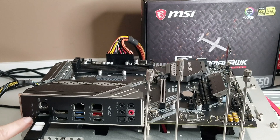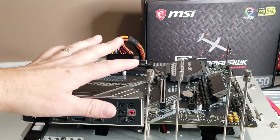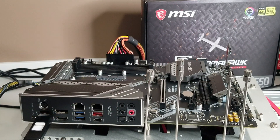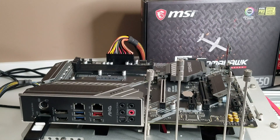There's a Flash BIOS button right here. All we have to do is turn the power on to the motherboard. There's a flash BIOS button — you're going to push that, hold it for about two seconds. You're going to see the lights turn on. Then just wait for the sequence to complete. The power supply will turn itself on, the lights should flash in sequence, and it should take no longer than about a minute at most. Just wait until you're sure it's done — it should power itself down, maybe it will power itself up.